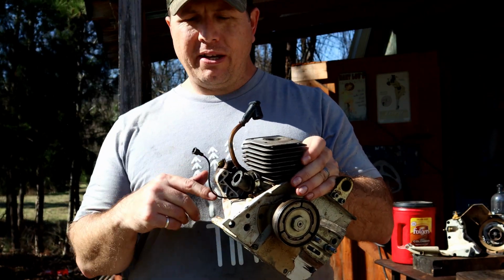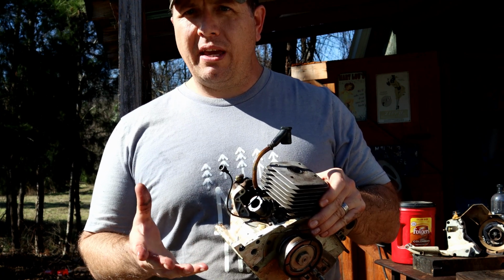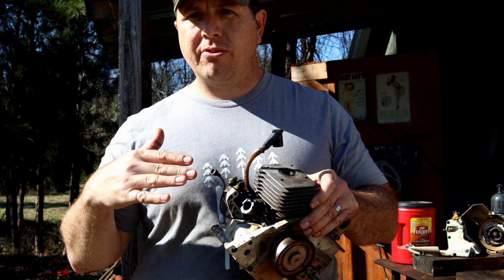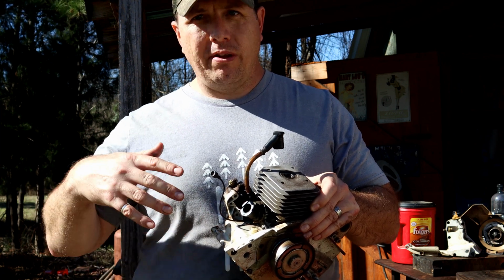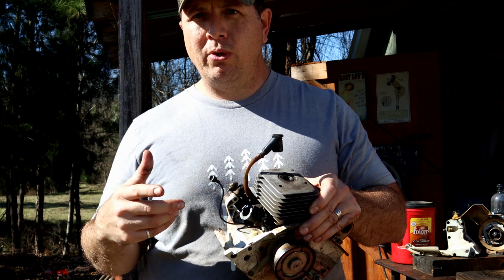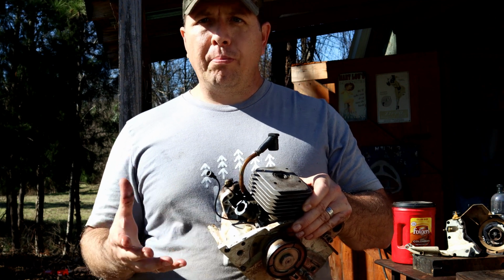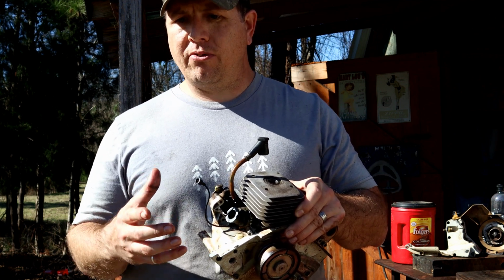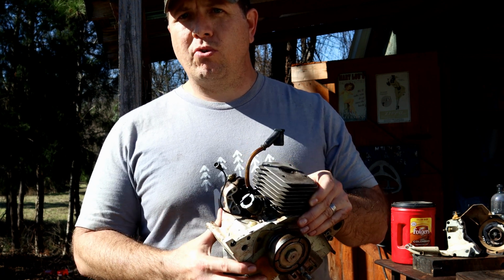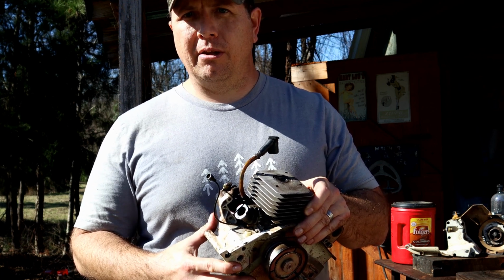If you missed my last video, I dug into this saw and found out what the problem was. It was actually the same problem on my 20 AV that caused it to explode. The carb wasn't delivering enough gas. It was delivering just as much air as it should, but the lower side that pumps fuel, the metering valve and pilot valve, or pilot needle, wasn't opening all the way. It wasn't allowing enough fuel in to really charge the saw. For some reason on this one it was running good at full throttle. I guess it's just able to run a little bit lean.